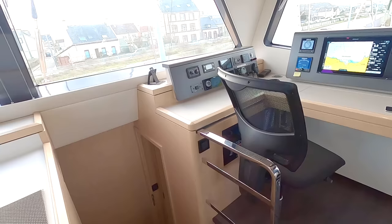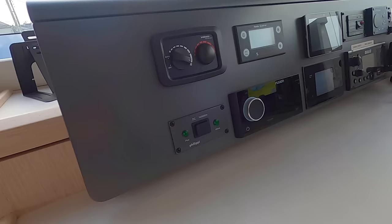After that, you've got on the boat an electric leak detector in case you need to check each week or each month. An electric leak won't happen just like that. It's something that will have been done probably on the boat. And if you have an electric leak detection, you just need to switch off everything and switch on each item to know which one is the problem and to fix it. This is the first topic.